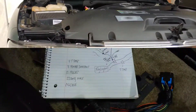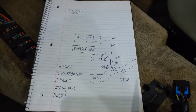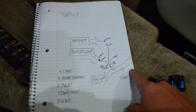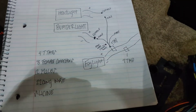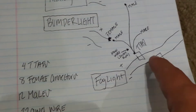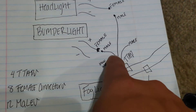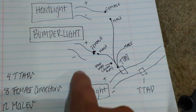I made a little drawing to help you guys understand it better. This is the fog light - that's the positive and the negative. You're gonna be using two T-taps, one for your positive and one for your negative. You're gonna be running two runs of new wire because the existing wire won't be long enough, so you'll need to buy some 22-gauge wire. You're gonna splice these together with a male connector so you can connect to your T-tap.